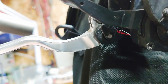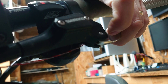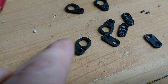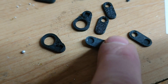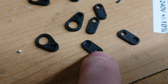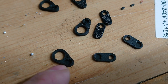The pin is retained by a grub screw, which is just in there. So the 3D printer strikes again — these are little housings I've made to house the hall sensor. These are the hall sensors here, and these little arms are for the magnets. You can see the magnet presses in there. That presses onto the shaft, it gets machined, and then this just superglues around the boss on the bottom of the brake lever.